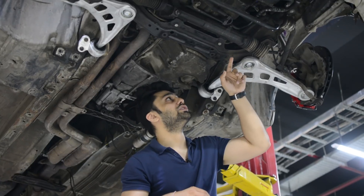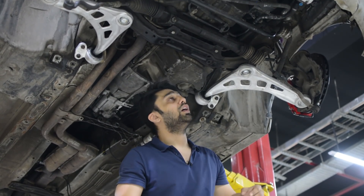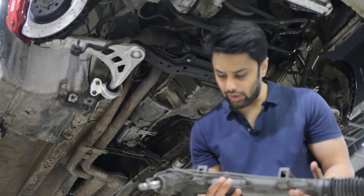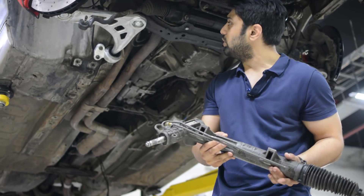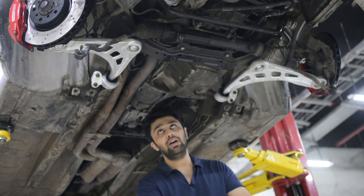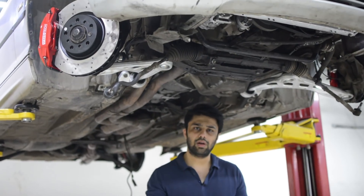The tire fitment is not done yet, and that is for a reason. When we saw the car on the lift, we observed a good amount of leakage in the steering rack, which is not a good thing — though understandable in such an old car. We have two options: repair or replace the steering rack. Thankfully DA Design had a spare steering rack from another E46 which looks to be in great shape. This will go in and make things handle just like it rolled out of the showroom, and after that we will have new tie rods going on to the steering rack as well.